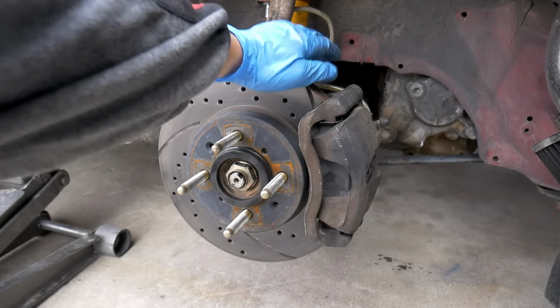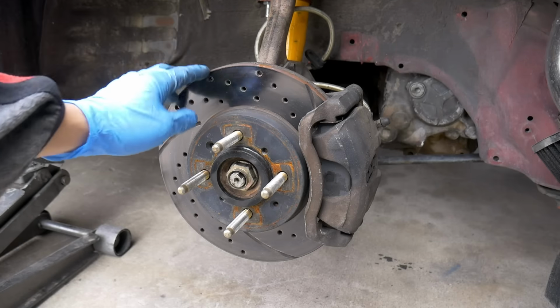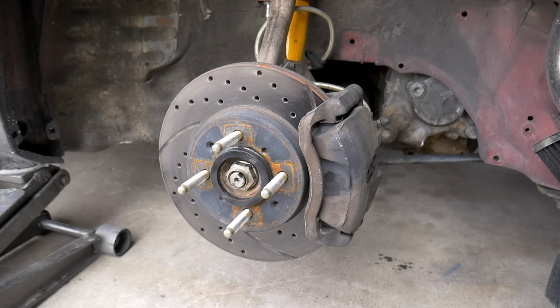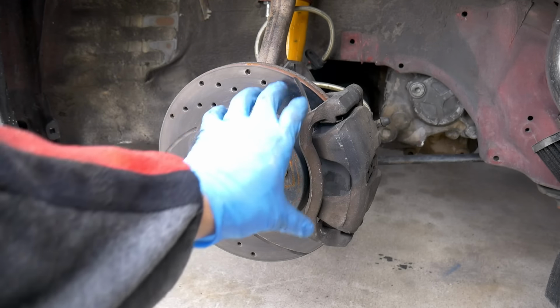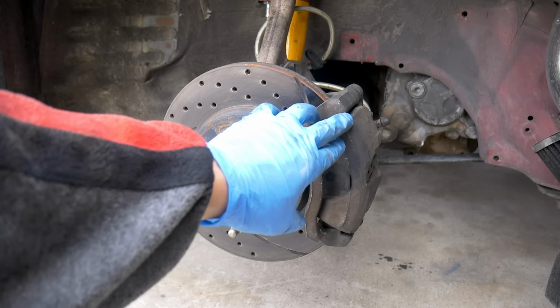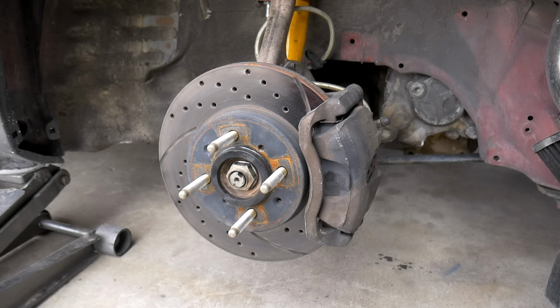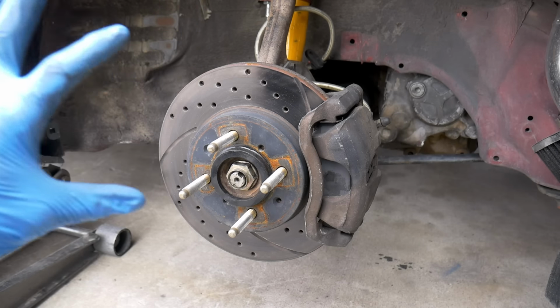I'm using some stainless steel brake lines. They're a generic brand. I also have, these are the 90 to 91 Civic Sedan EX front knuckles. These have the 10.3-inch rotor and the larger 9093 Integra-sized caliper. So it's a little bit bigger of a brake upgrade using all stock components without using the 9093 Integra front knuckles, which throw off the suspension geometry.